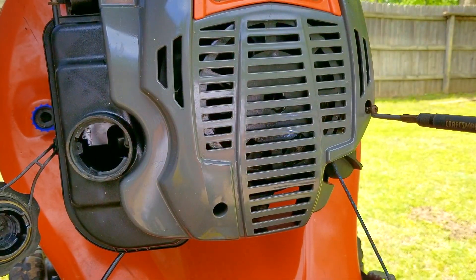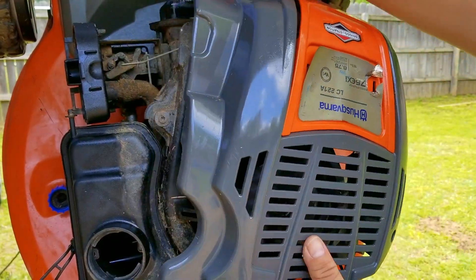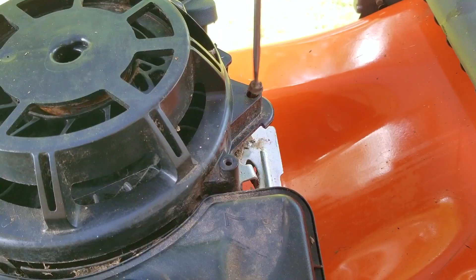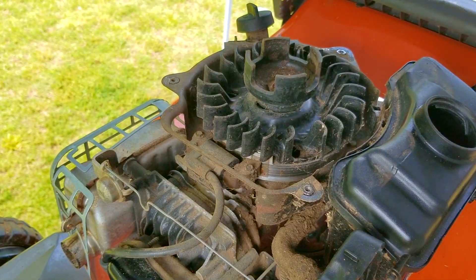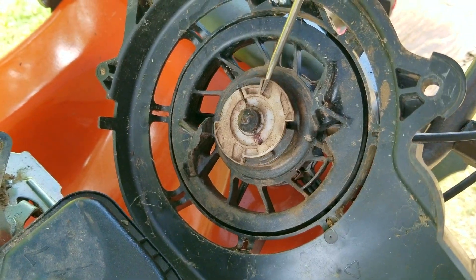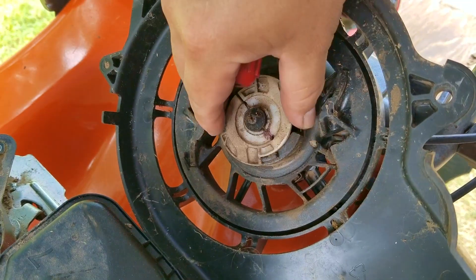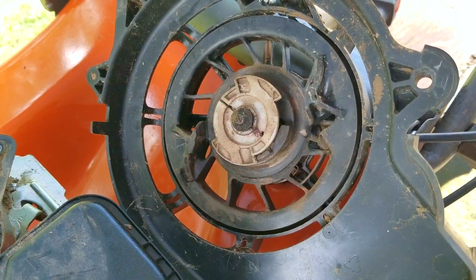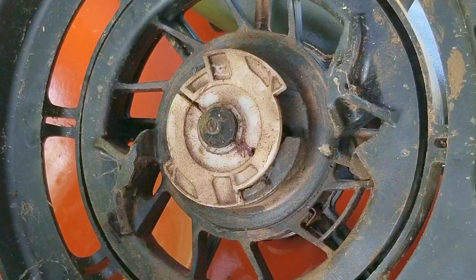I'm finally going to remove the top cover to get to the recoil. So far, I've spent the last hour cleaning up the dirt and grass on this mower, so this is when I've got to make a choice that will decide if the last hour was unnecessary or well worth it. Here's the recoil assembly — it's part of the engine cover because it's made from a single piece of molded plastic. There are supposed to be three fasteners that hold it to the engine, but one of them is not the original one, and worse yet, one of them is missing, which is not a good sign. Under the recoil pulley is where the pawls are supposed to be located, retained by a guide which is held in place by a large retaining clip — but the clip and pawls are missing. The pulley still spins, but since the clip is gone, it allowed the plate to move, which then allowed the pawls to fall out of the assembly. I think the missing fastener on the recoil allowed the front of the assembly to move away from the engine, which pushed the pawls against the guide plate, and the force was enough to release the clip. After that, the pawls were lost.